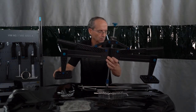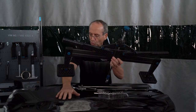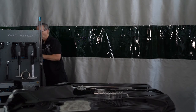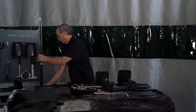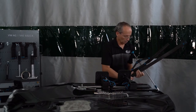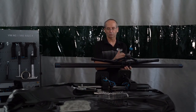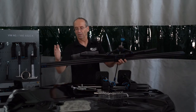As we start getting to pulling bars — this is our smaller of the two that we have. I'd rather have it extend out further, so I'm going to grab my other longer one. This one you can actually loosen and slide the pull point wherever you want on the bar. The other smaller one has a fixed point in the center, so you're limited on what you can do, but the longer one gives you the availability of stretching across a long panel and being able to pull over to the side if you need to.